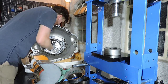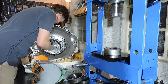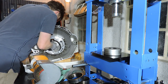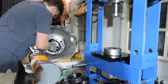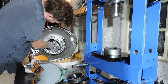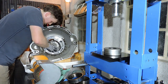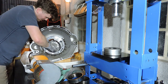All right, my spline is grabbing into my DG drum. And that's it. I've got my planetary gear set in. That carrier ring is snug fit. I've got the teeth around here in that carrier ring. And now let's see if I use the end. You can see the action. If I'm turning it the other way around, you can see the action on the planetary gear set, just like that.